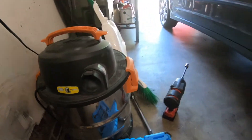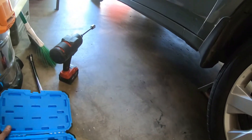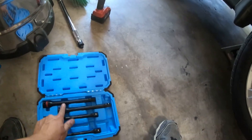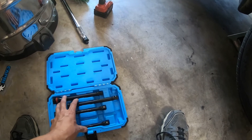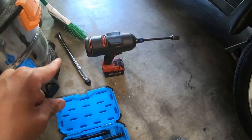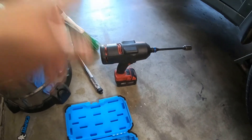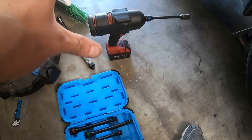On this 2009 Honda Accord, it calls for 80 foot pounds of torque. The way these torque sticks work is that you've got various thicknesses. This kit goes from 65 foot pounds up to 140 foot pounds. The thicker the wall of the extension, the more it's going to allow the gun to apply that foot-poundage. This gun is my Milwaukee impact wrench — I've had it for about four or five years, amazing tool. I think it's rated up to around 400 foot pounds, and I've never had a bolt this thing could not beat. The batteries just last — it works phenomenal.